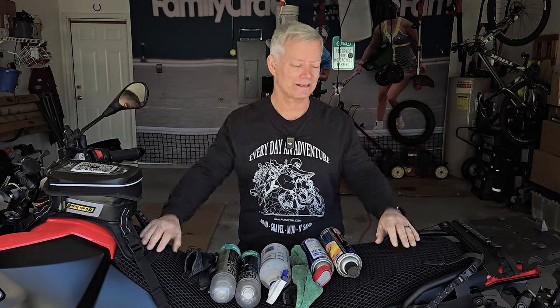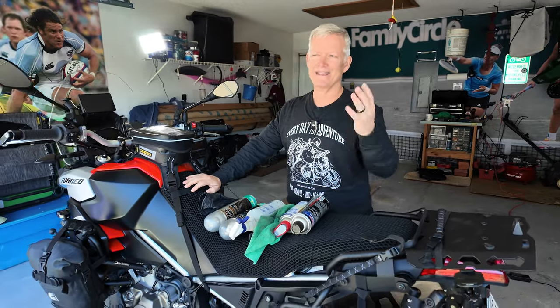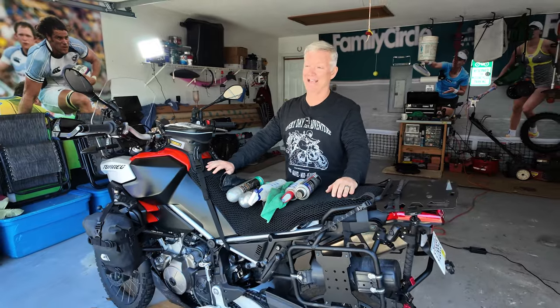Old, old motorcycles — like when I grew up in Africa and we had this old beat-up 100cc Kawasaki that had a standard chain with no O-rings — I cleaned that thing with everything, even gas sometimes. You could do that with those old chains because they didn't have the O-rings and X-rings that seal in the grease inside the internal part of the chain. But with new modern chains, we have to be more careful and use solvents that aren't going to damage those seals.